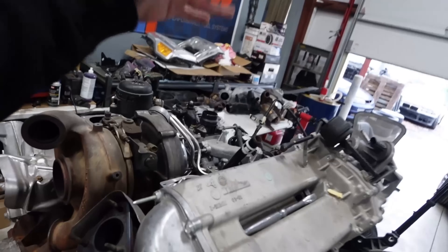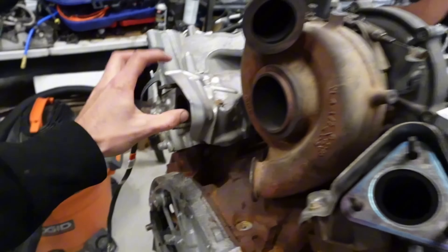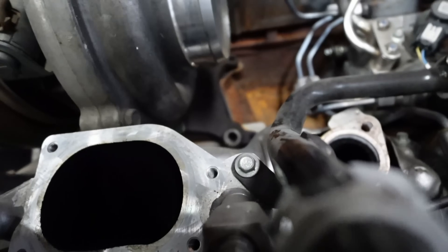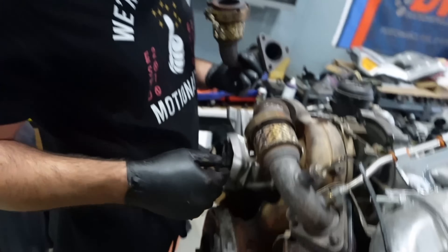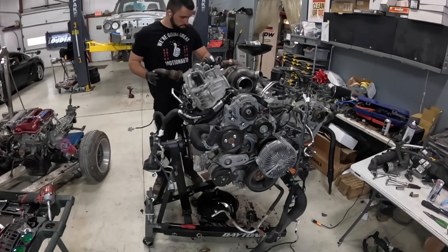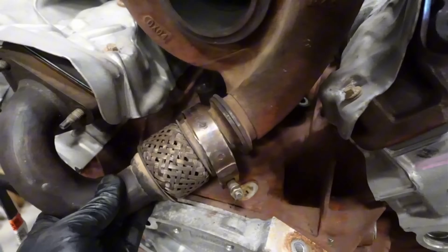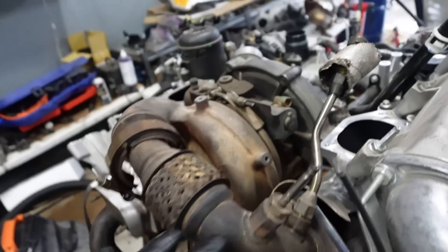Sean's got this thing apart pretty well. The 2020 turbo is off and you can see the 2017 turbo goes right on. The next concern was figuring out if the exhaust manifolds — the up pipes or swirl pipes — actually mount on correctly. So we tried the 2017 up pipes and they seem like they fit perfectly, all seated up on the flange. V-band connections all lined up. So the 2017 turbo up pipes and all that stuff will work on this engine — we just wanted to confirm that.